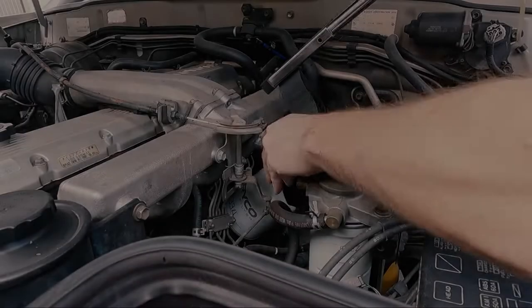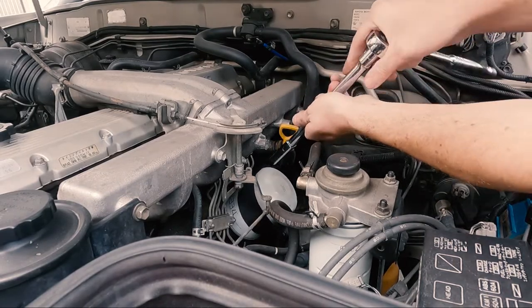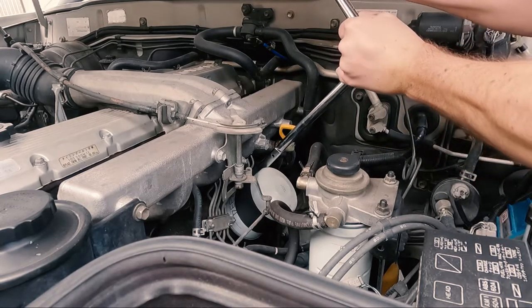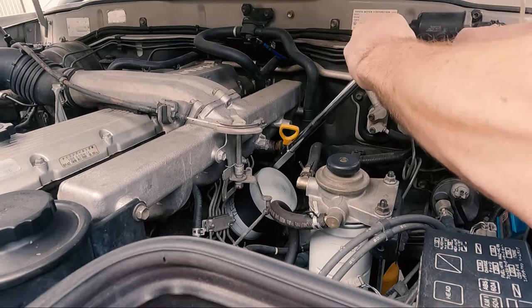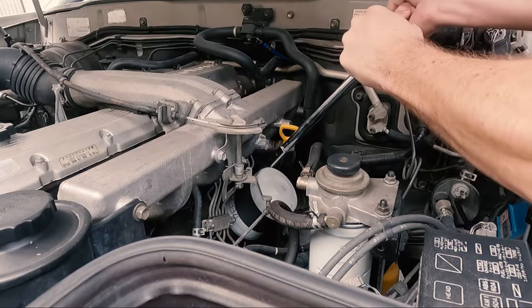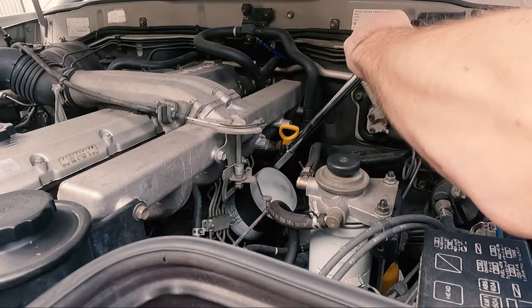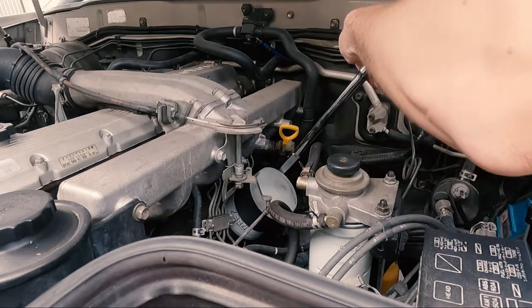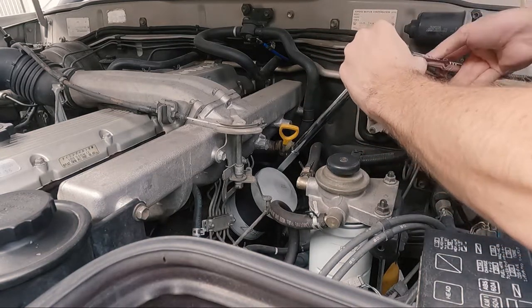Change the oil filter. So with these, wind it on so it goes tight. Be careful where you're turning. There are injector pump lines down there. Geez, she's tight, but it's coming. So with these filter strap ones, just move them around as you go. Eventually you get to a point where you can do it by hand. Reckon we're at that point now.